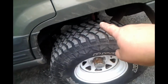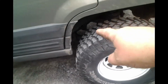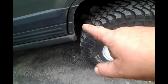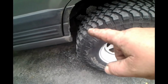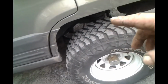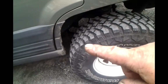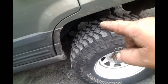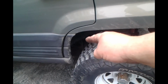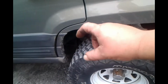Not to think that we forgot about the rear. We do have new Rubicon Express 4.5-inch coils for the rear. We also have, I'm not exactly sure, it's been a while since I bought them, but I have new lower control arms to remedy some of that. Put our pinion back in the correct angle. They are from, if I'm not mistaken, don't quote me on this, a 2007 TJ. They're the rear uppers. There is a difference in the mounting. The ZJs, the mounting area is a lot wider than the TJs. I have to come up with some plate washers or something.